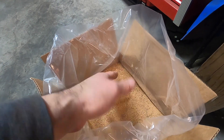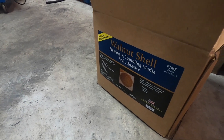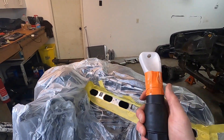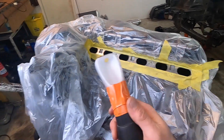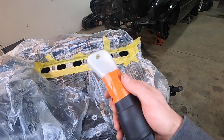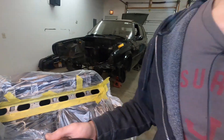You can get fine or coarse walnut shells — I think I got the finer version, and we'll see how that works out. What we need to do first is make sure we have the right blast tool, and then we need to clock the cylinder we're doing first to make sure the valves are closed, otherwise all the walnut media is going to get inside the cylinder wall, which is really bad. So let's take a look at the tool I'm going to be using to do the blasting.